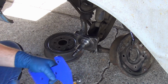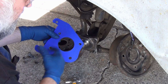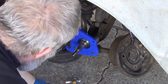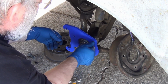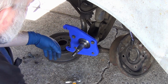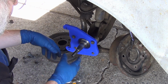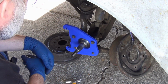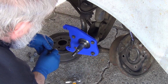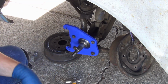So let me go open these holes up here. I had a slightly bigger drill bit. I had to put it in the drill press because the chucks on my drills only go up to 1/2 inch. So I only drilled this one out. If it works okay for that, then oh, look at that, nice. Nice. That means that these 3 are okay, and I only have to screw with that one. I mean, I've got the tolerances pretty damn tight, so they both may need to be out just a little bit, but okay. Yeah, see, that's more than rigid enough.